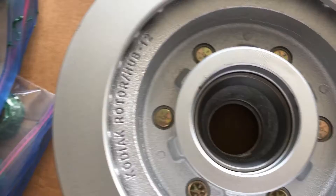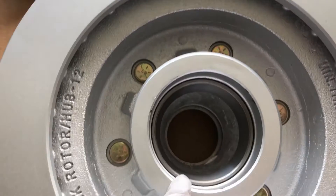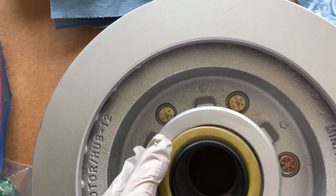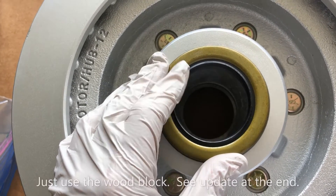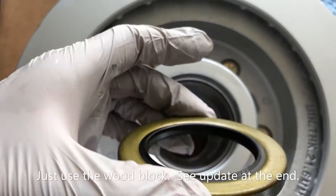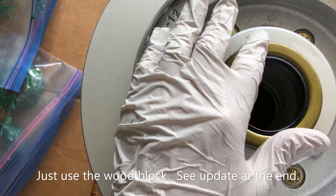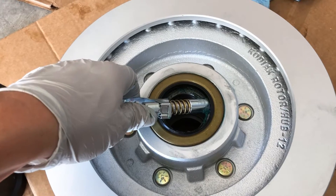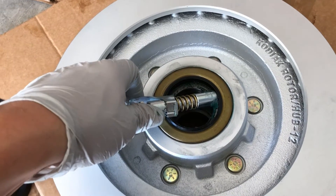I'm going to drop the bigger inner bearing — you've got outer bearings (the small ones) and inner bearings (the large ones). It'll only fit one way, conically, so we fit it in conically. Then we press in the dust cover. A lot of people use wood blocks for this, but the seal is right on the border, and the last thing I want is a nick in that seal. So I'm using a very large socket to make contact only with the outer portion.